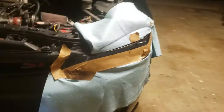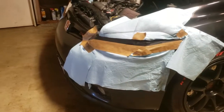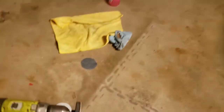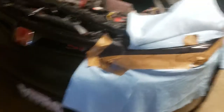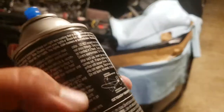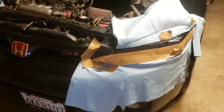Alright, there it is, nice and prepped — the area is nice and ready. What I also did was sand down the headlight with the 500 grit first, 800 grit and then 3000. I didn't buff it out yet; I'm going to throw this on there, allow this to dry, then I'll buff off the headlight. It should come out nice and clean, so I'm going to go ahead and spray it.